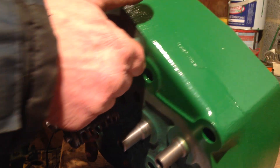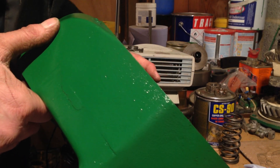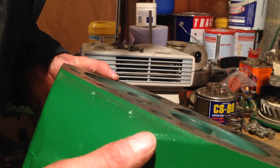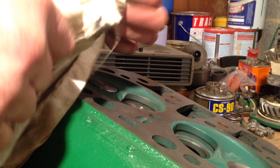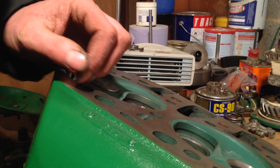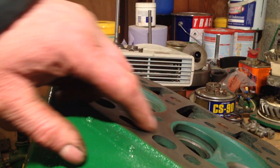Just put that back up on there, we'll tip the head over - hopefully without knocking the camera off, a bit of shake there, sorry. Then we'll just clean the valve lapping compound off the seat. Yeah, it's polished that up nicely - this one was probably the worst one actually. It just had a little bit of rust on it, hoping you can see that. Yeah, that's got that done.